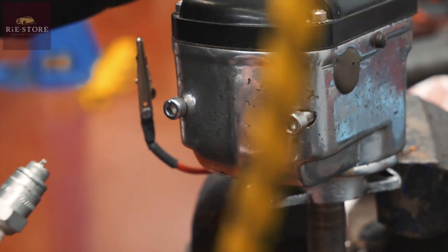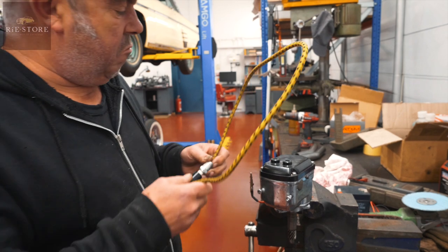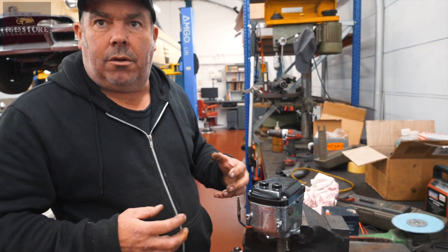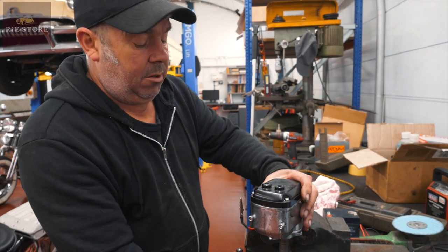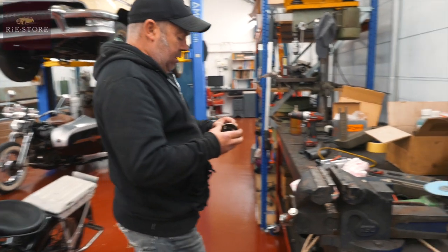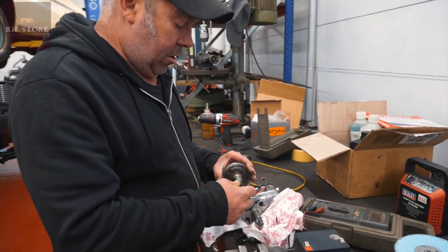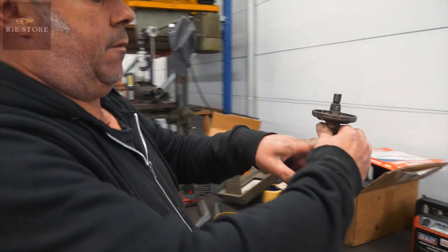So we know it's sparking and generating enough current. It might take a little while to start up but then it re-energizes itself — everything's got current going through it and it all dries out and picks up. It probably hasn't been run for years and years, but ideally you want that helical gear to engage with the gear that comes off the scavenge pump drive.